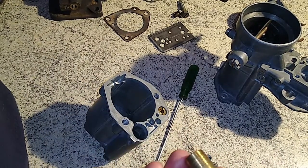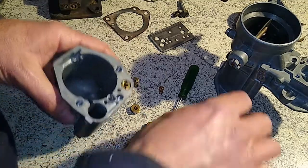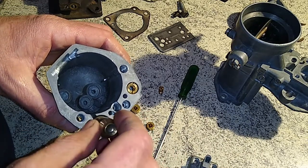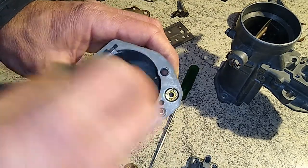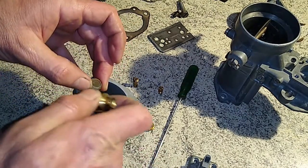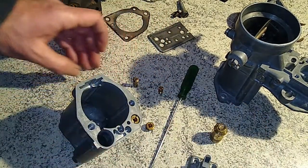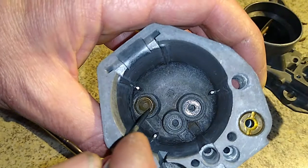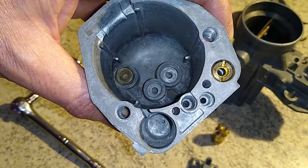So that covers your acceleration pump. We have a series of jets in the bottom of the float bowl. When they fill this bowl, there's a little one-way valve down in here with a little ball bearing or plate in there — it stops the fuel when you plunge down from rushing back into the bowl and actually pushes it out the jet. These two work together. I've just put the accelerator pump check valve back in — this guy down here has a little bit of gauze on top with a one-way plate, which feeds into the accelerator pump well.